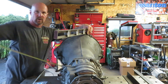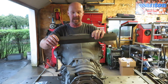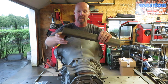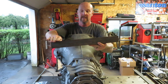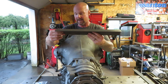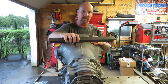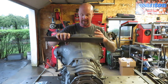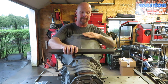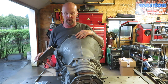You're looking at right about 14-3/4 inches, so if we cut them about 15-1/2 inches we should be pretty good. Now, if you want to mount it the other way, just take two inches off — cut them 13-1/2 inches — and that edge right here would be where you'd weld your strap versus the other orientation. I don't think I'm going to do anything other than put this on there and see how much rigidity it has. It might be a good idea to put the cross piece on there too, and we'll just have to see how it flexes once I get it made up and bolted onto the transmission.